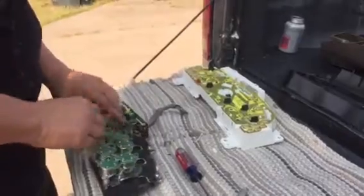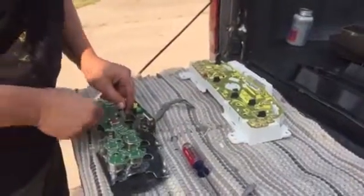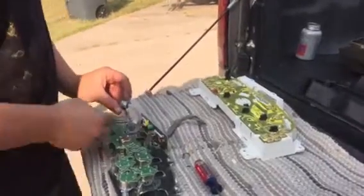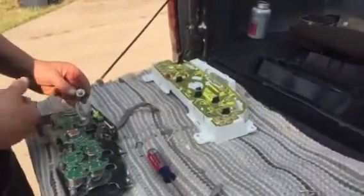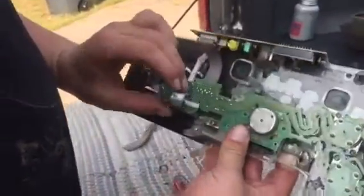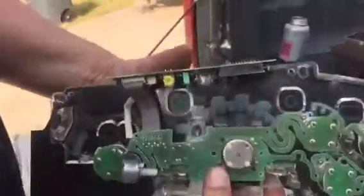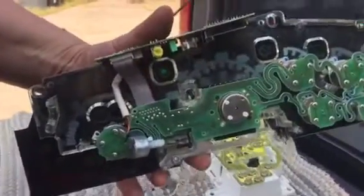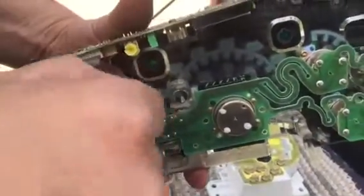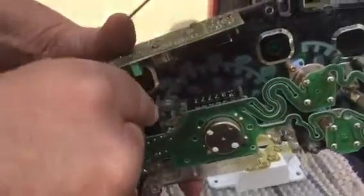So the genius that is Ford has this little motor, and this is the new worm gear right here. It just simply slides on. I use a little anti-seize. And if you look in there, you can see the gears — they just simply turn. And that adjusts your odometer.